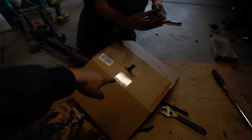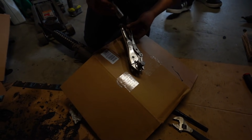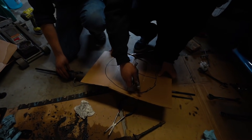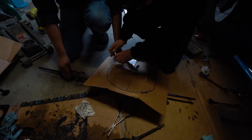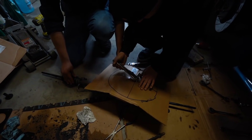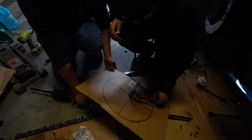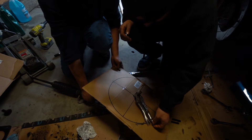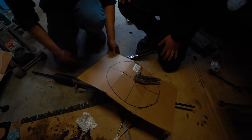Now we're going to try and center the new rack. We're using a cardboard piece with a sharpie hooked to the end of it to draw a circle, just to make sure we get it centered correctly. There's full lock right there. We're going to center it — count the turns to full lock on both sides: two and three-quarter turns each way. Half is right here.